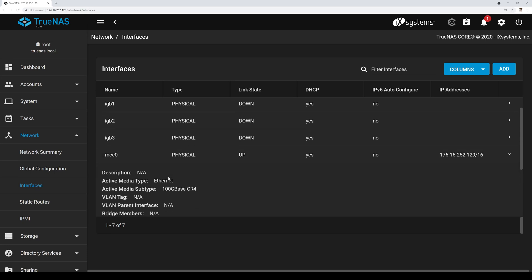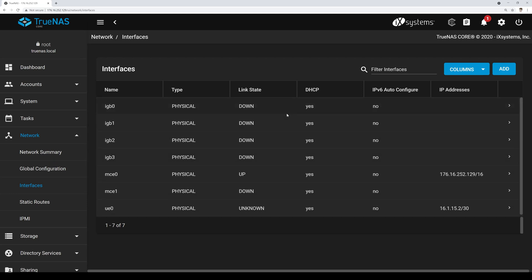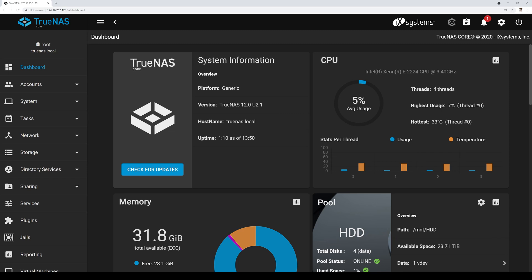The card fits — that's probably step one of HPE's qualification process. We're using a single 100GbE interface; you can see all the other 1GbE interfaces and the management interface. Everything is supported on the MicroServer platform, though you would need an additional RAID card — which would have taken up that single PCIe slot and cost you the 100GbE NIC. The CPU is only four threads — four cores, no hyper-threading — so there could be advantages going to a faster processor. With a four-bay platform hitting the 3 GB/s range, you're asking quite a lot of a MicroServer.